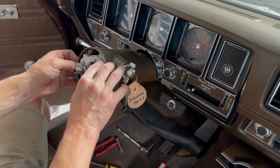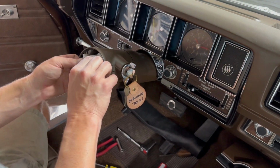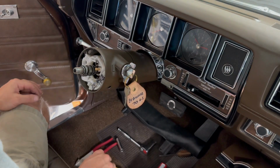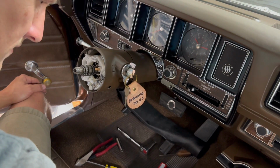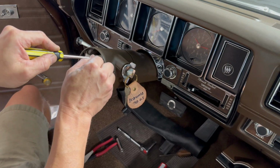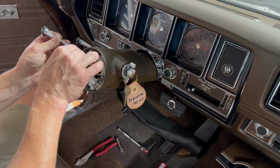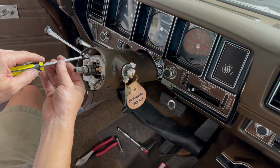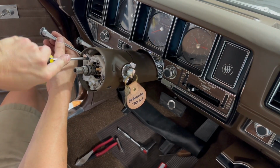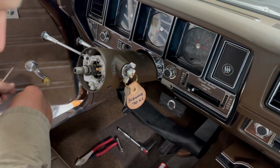You know, your screws lined up. Something doesn't feel right. Oh. There we go. There it needs to be. We're turning right. Where are these things? Screws. Hold the turn signal switch in. Let's get the lever in. Oh yeah, and disconnect the battery when you're doing this. If anything, it'll save your battery power when you've got all your doors open and lights running. Okay. Hazard switch.